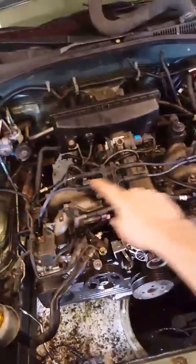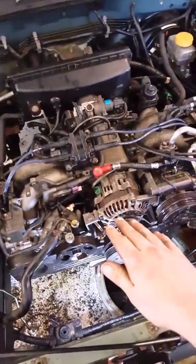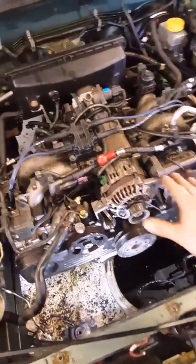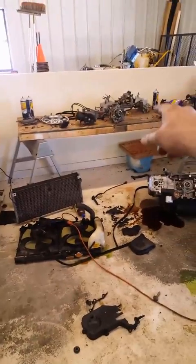The intake and the wiring harness and all of the electronics from the EJ25 were taken off and installed on the 2.0. Every single sensor too — your cam sensor, your crank sensor, your oil pressure sensor, your knock sensor, everything. It all got swapped over. Your coil, your wires, everything was swapped over.